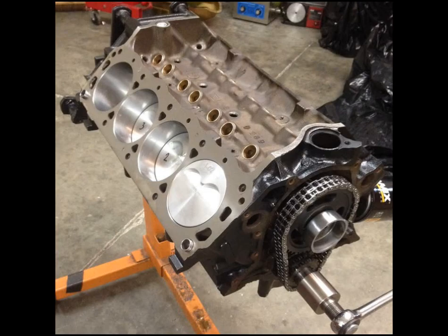For the rules, we had to stay with a specific amount of overbore and the same stroke as the factory engine, but you could play around with some of the bottom end parts. This one came out to be, if I remember correctly, about 292 cubic inches. We used an RPM — back when RPM made cranks — an RPM small block Ford crankshaft with a 2.87-inch stroke.